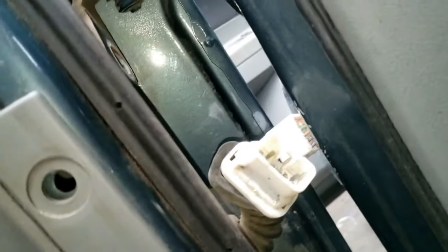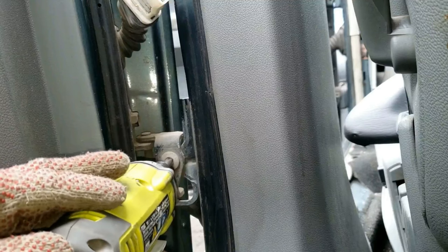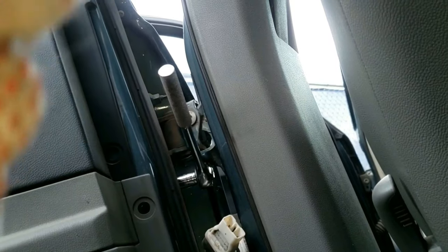Anyway, here's another close-up. Take a look at the top and the bottom of these center hinges with a bolt. If your car has this, you're lucky and you'll finish this fast. If not, removing the rear door will take just a little longer. So use an impact gun preferably, or a ratchet with a Torx T50 bit on the top and bottom of these hinges. If difficult to remove, use a breaker bar.